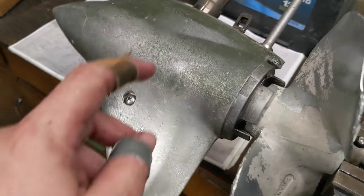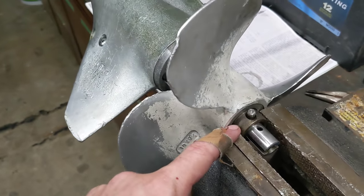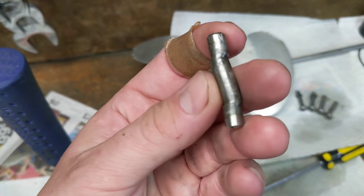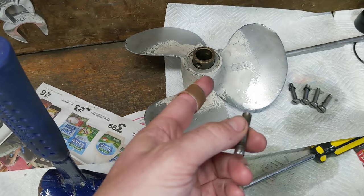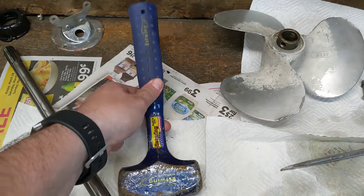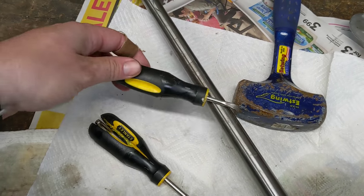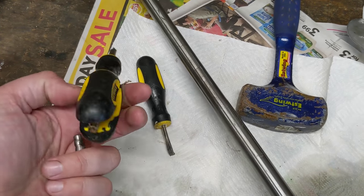To get those roller bearings out of there, I guess I'm back to trying to get the prop off. I finally got that pin out and it is very bent. Apparently this is supposed to be some sort of shear pin, but instead of shearing it just bent really awkwardly, so there was no way to get it out of there. When I was hammering it before, my only problem was not using a big enough hammer. I also destroyed two old screwdrivers I was using as punches, but that's okay because these were broken already — they're just more broken now.